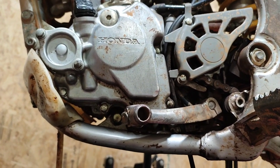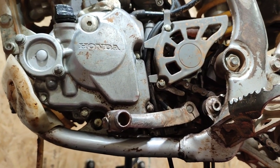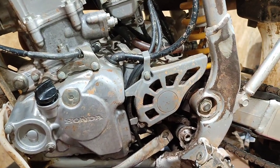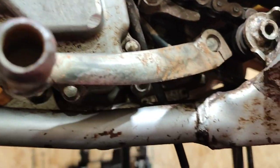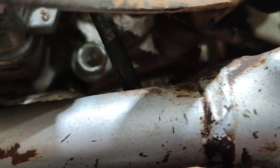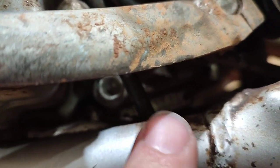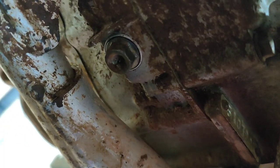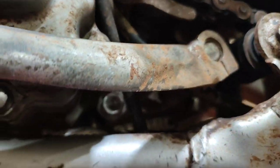Oil filter on the engine side, transmission fluid on the other. There are two drain bolts on these, so don't get confused. On this side, even though you're changing your filter here, the drain bolt right there is going to be for the transmission side. The one for the engine oil is going to be right there. So that's your engine oil underneath, and then your transmission side is here.